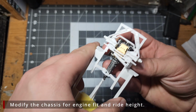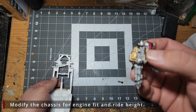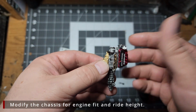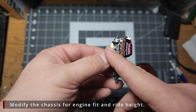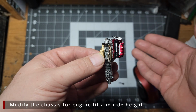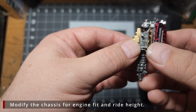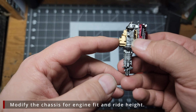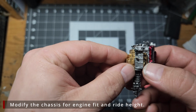Now I've looked at a couple of solutions for this. There's about 3. The first would just be to 3D print a dry sump oil pan, which would be a much flatter oil pan. To do that, you'd also need to find a location for an external oil reservoir and an external pump, and I'm not sure I have that kind of space in the engine bay. Option number 2 would be to just smash the size of this part in the 3D slicing software so that it's only about 1/3 of the size that it should be. So it would fit, it just wouldn't quite look right.